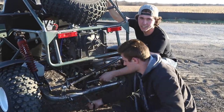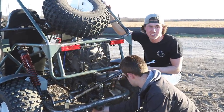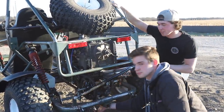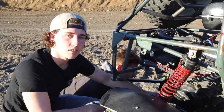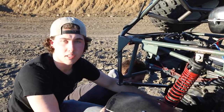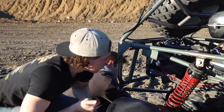We got to drive it to our heart's content. Now we'll get some flybys on this road to get an idea of top speed, because we might consider a rear gear change. If it survives that, we'll try some launches and some dirt. The suspension is holding up and temperature is staying in check. As far as carb tuning goes, we haven't synced these carburetors yet — that could be causing the breaking up, since it's a two-cylinder and if the carbs aren't perfectly synced one runs leaner and it'll pop.